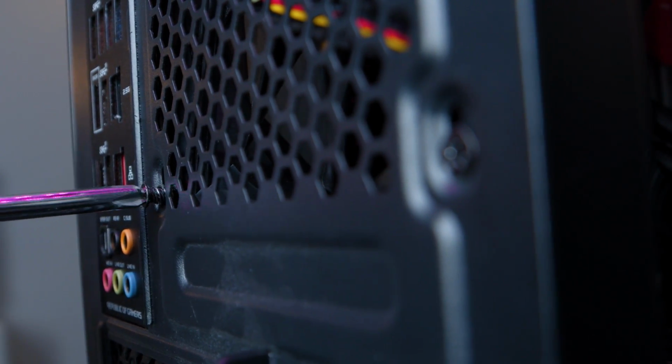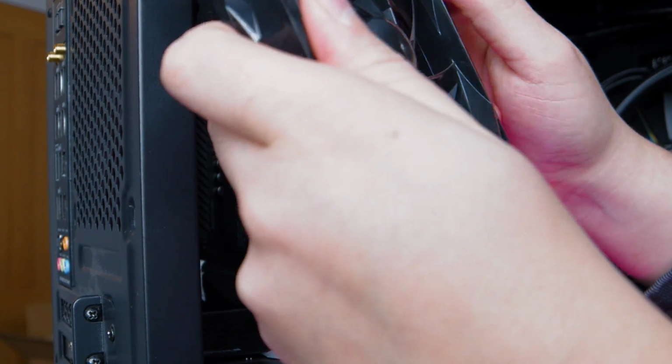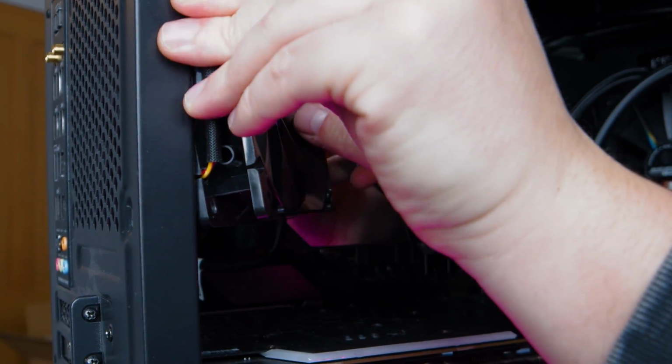If there's enough cable to let you rotate the fan and have the cable travel a little further around the edges of the fan's frame, this can let you wrap the cable around the frame and connect it to the header while keeping things neat and tidy. Otherwise, tucking the cable down the side of the fan's frame is usually a good idea, and you can fold it up and tie it a little if needed. Figuring out which way to rotate a fan might take a bit of experimenting, but it's one of those small things that can turn good cable management into great cable management.